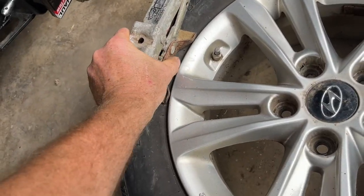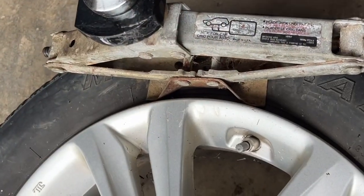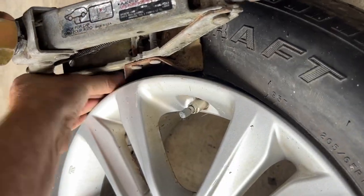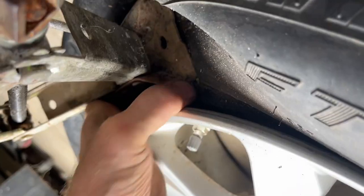Place the jack close to the bead, with the wheel underneath the nut. Jack it up — you can see it's adding a lot of pressure to the bead. The bead is pretty close to releasing. At a different angle, to secure the jack you can put it behind the nut. At this point the bead is off.